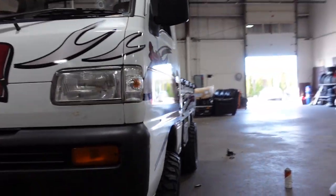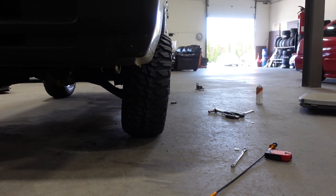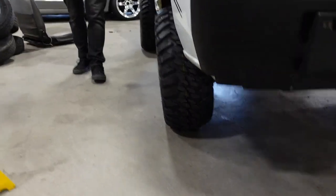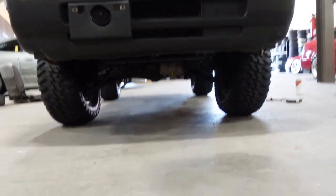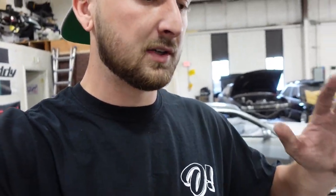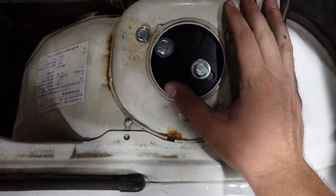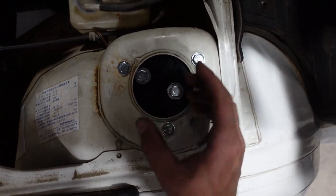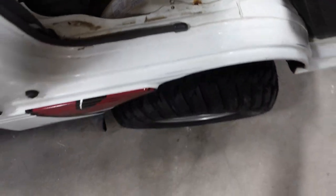Wow, look at that — it looks so goofy. Oh my god, there's so much camber on this now. The toe is definitely messed up, which is to be expected, and the toe does affect the camber on this suspension setup a little bit. I can assume some camber will come out when I adjust the toe. I tried to put the top hats oriented to have some caster control and some camber control, but it didn't work out — looks like we're gonna have to rotate it for max camber on these plates and hope that correcting the toe makes it look less goofy.